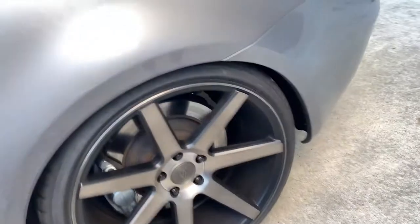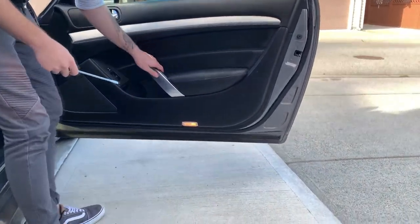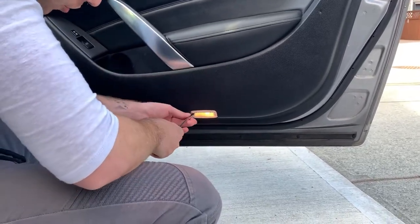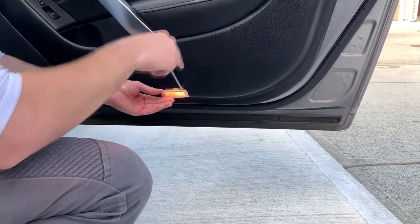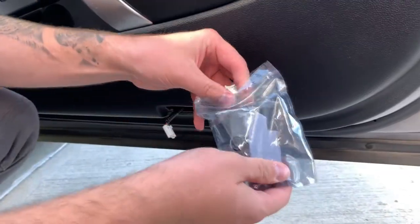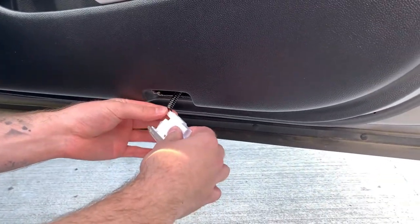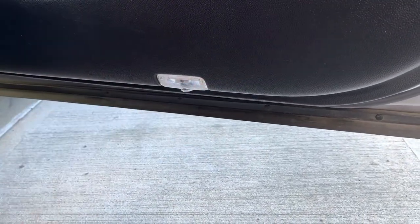Damn, that fitment though — hella tight. Once again, set your lights down on the ground somewhere safe so you don't step on them. Gently, gently wedge your screwdriver just like so to pry the light out. Remember, trim is very delicate and you do not want to damage your door panel. You want to be very, very gentle. Don't rush the process — take your time. It pops out just like this. Grab your new LED projector light. You can see the connector was on this side, so they all actually go in the exact same way. Simply pop this in, slowly guide it in. And that's it, guys. That's how it is.